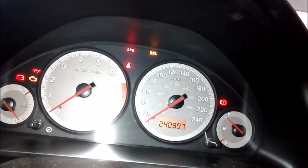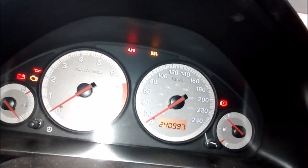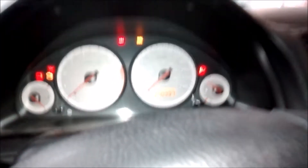I'm going to try plugging and unplugging this repeatedly to get it to malfunction. It seems to be working well so far... and there we go. It stayed off, meaning the car thinks the seatbelt is plugged in, but as we can see, I don't have the seatbelt plugged in — yet the light is still off. So I plug the seatbelt back in, the light stays off and is now correct. Unplug it, and the light comes back on, which is proper. So one failure in the past triggered the SRS light, and now it's staying on.